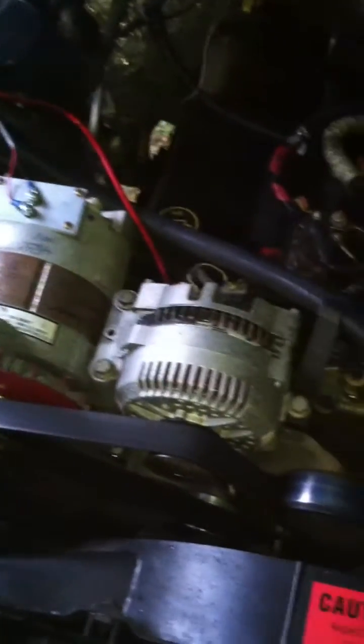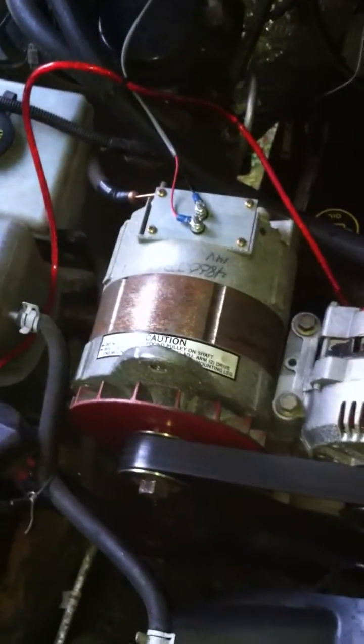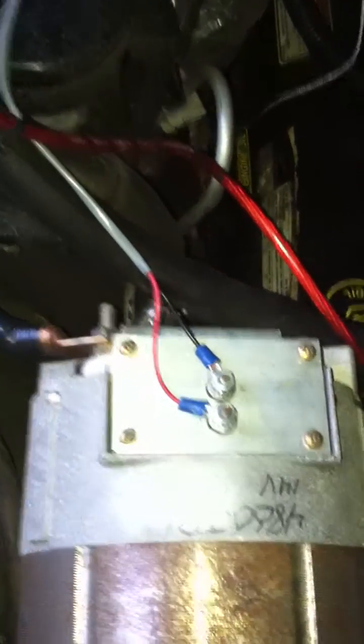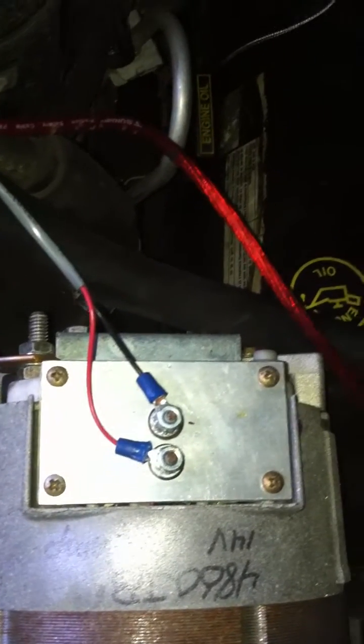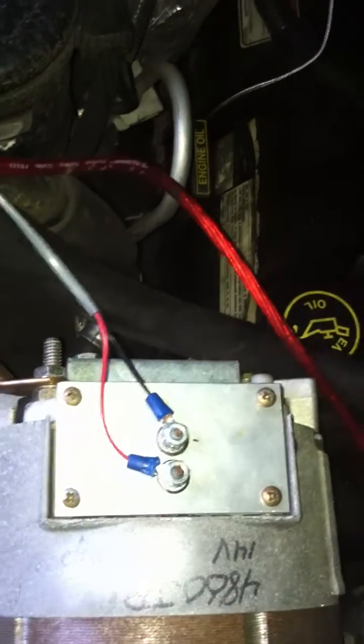Now here we got the pair — the little factory 160-amp alternator and then my Boomhauer-installed 320-amp alternator. Now remember those red and black leads coming from the back of the truck — don't be mistaken, these two leads do not come directly from the battery bank. Before the battery bank, they go up to that voltage regulator. The red wire lands on the field portion of the voltage regulator, and that black wire goes to the ground — chassis ground.